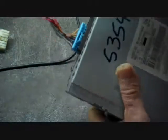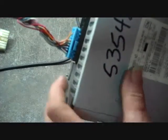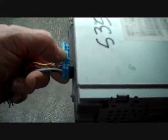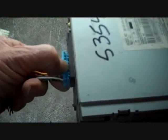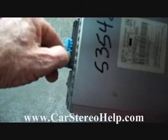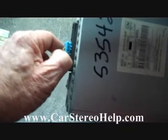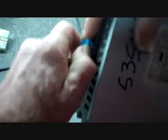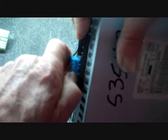Connectors are a little bit different story here. We have the main connector into the back of the radio. In order to remove this connector, I'm going to use my thumbnail and push down on this little trigger at the top of the connector. This will allow the lock on the connector to release, and usually you can wiggle this connector loose once pushing that trigger down. This can be difficult at times.